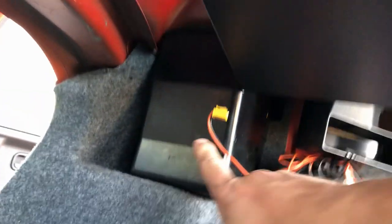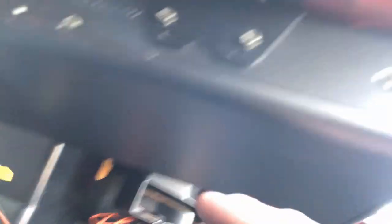On the passenger side I have to remove the CD changer because this car had a CD changer, and you can't slide the speaker toward the inside of the car without removing it. So it's a couple of Phillips on each side, then unplug the electrical, drop that down, and be able to get this one out.